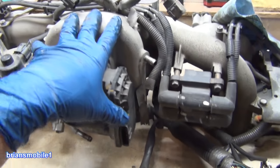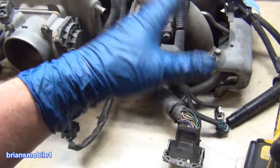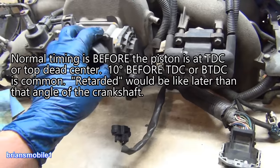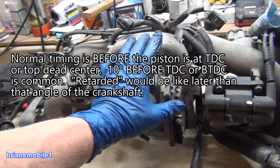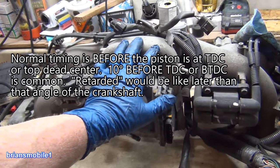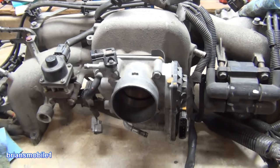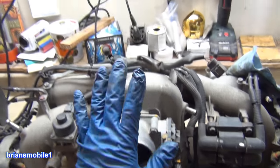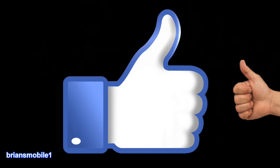All that oil and stuff in there — talk about crapping its own pants — it's dirty, it's gross. What happens if the oil gets in there? Ultimately it can get on the valves, it can carbon build up, it can cause pre-ignition and then makes your timing retard. Basically what it feels like if your timing gets retarded is your car goes gutless for a second — just brace yourself. So that's what happens more often than not to protect it from having bent connecting rods. Nobody wants that. Thanks for watching — be sure to click like and subscribe.